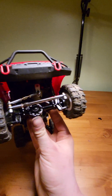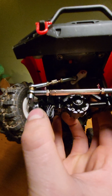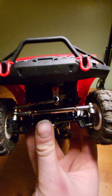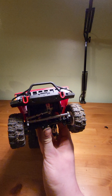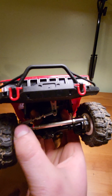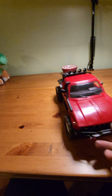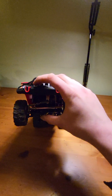I just recently installed this kit, which utilizes the plastic axle housing but adds cast aluminum steering knuckles with bearings. It's all roller bearing universal joints with nifty little steering joints, an adjustable tie rod and drag link. One huge benefit is you no longer get any bump steer, especially when set up with the tie rod on top of the steering knuckle and the drag link off to the passenger side — that really eliminates bump steer.